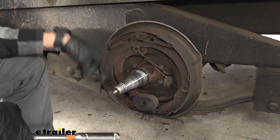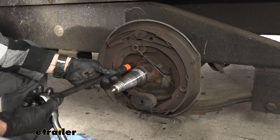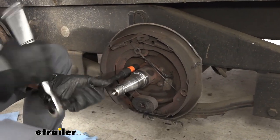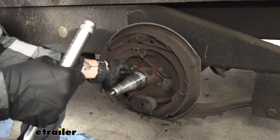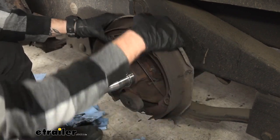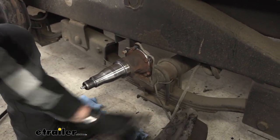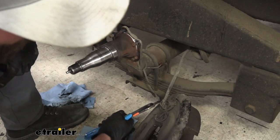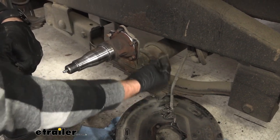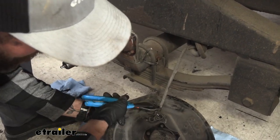Next, we can go ahead and remove our brake assembly from our brake flange. What we need to do is pop off the nuts from these five bolts right here, and we're going to want to save these because they do not give you any more in your kit. Now we have all those nuts off, we can break our brake flange free. Then we're going to cut our line for our electric brakes. I'm going to leave some excess just in case anyone ever decides to switch back, but most likely won't once you're switching over to disc brakes. We'll cap those off with some electrical tape.